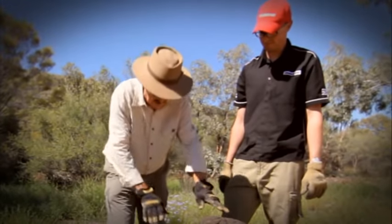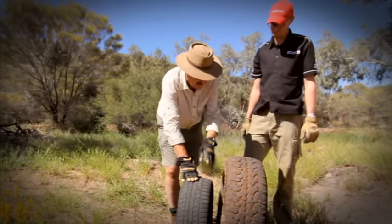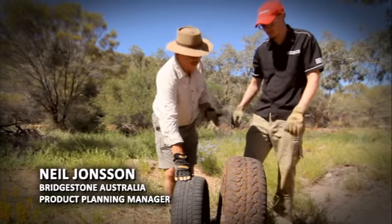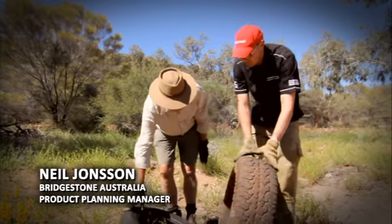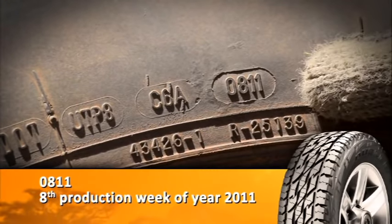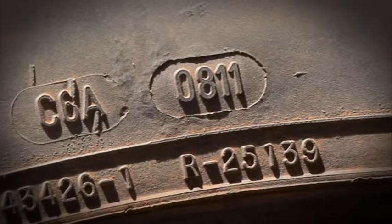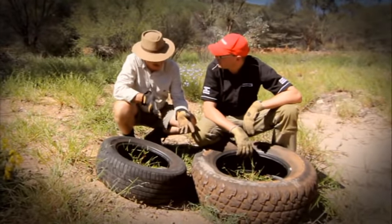I know one's a car tyre, but that's not the issue. I know I'm going to be wrong, but that looks a lot newer than that. And it obviously is a trick question - this is the newer of the two tyres, and how we tell is via the date code on the side of the tyre here. From this one here we can see it's 0811, which is the week and year. So that's less than a year old from when we're doing this.